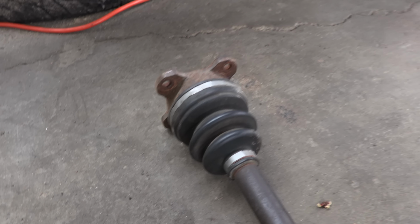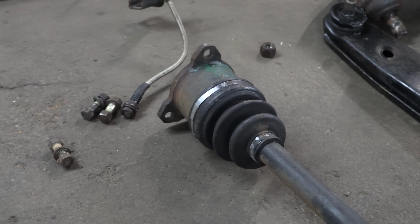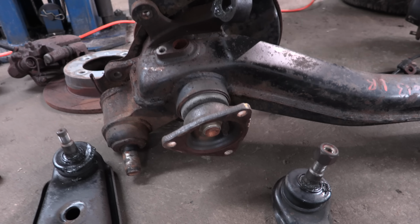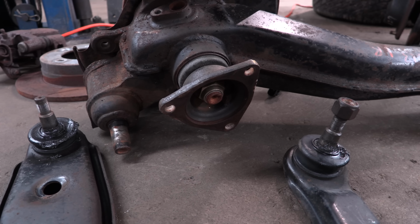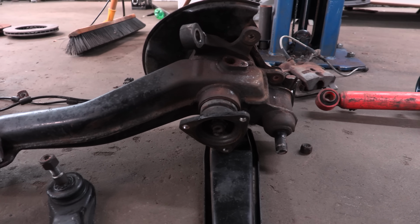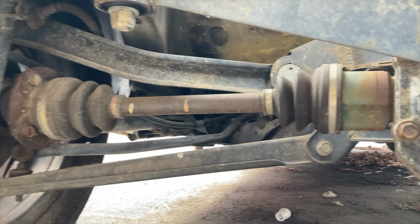The biggest problem today with doing a 4-bolt rear end swap is obtaining the 4-bolt axle cups. The cups are the things that the axles bolt onto to deliver the power to the hub, wheels, and pavement. I've been hunting them for years without social media and come up empty everywhere. It's sad. The 4-bolt axles do not fit 3-bolt cups, and nobody makes them, so unless I can find a 4-bolt Mitsubishi all-wheel drive something in a junkyard somewhere, then this swap is not an option for me.